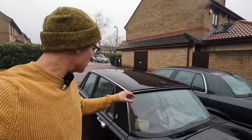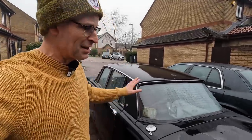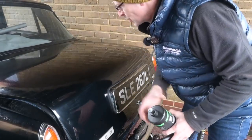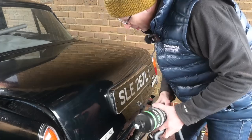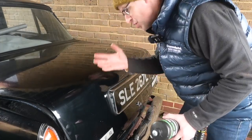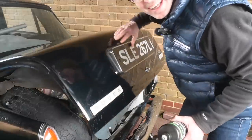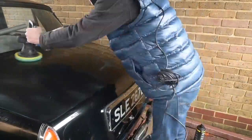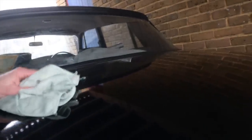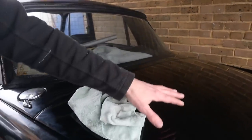The lads at Hawk did a great job of actually polishing the bonnet for me — I really thought that bonnet was going to be an absolute goner in terms of paint, but they did bring it back, so hopefully we can do the same thing to this. Always be aware when a car is wet — the paint is going to look worse underneath that than it actually is. I realise it's not a vital part of getting the car back on the road, but I really don't want this horrible scuzzy etched paint being part of my newly complete car. So I'm going to get the one cut from Diamond Bright on this and make it good. And the great news about having the car back here is I can do Junk from the Trunk again! That is significantly shinier now — it's got a lovely gloss to it. It was like an old lace curtain etched into the paint, but now it looks really nice. Boot lid looks decent, deco panel looks good.